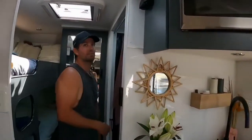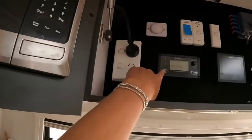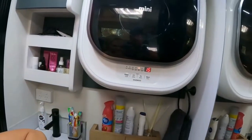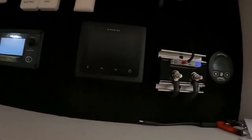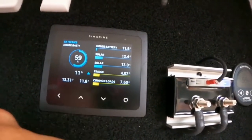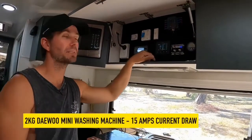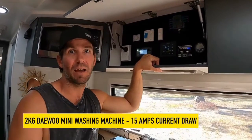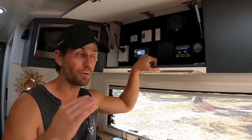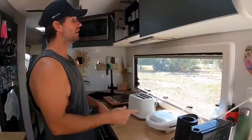It runs the water pump but also runs power at the same time. You will have to turn the inverter on — just press that button — that turns the combi on under the seat, the 3,000-watt inverter. As it pumps water in and starts turning, it's still pulling under 10 amps. When it is doing a full spin cycle, it pumps up to about 15 amps, but it doesn't spin for that long because it's only a 2-kilo washing machine. Really efficient and easy to use when you're off-grid. We run it all the time — we generally run out of water before we run out of battery power.